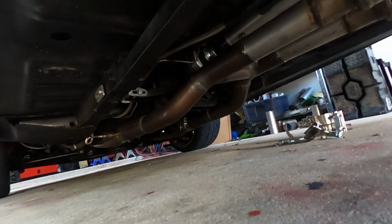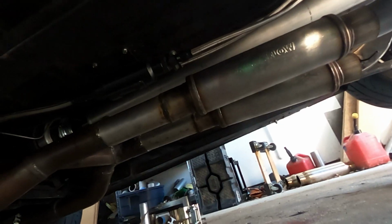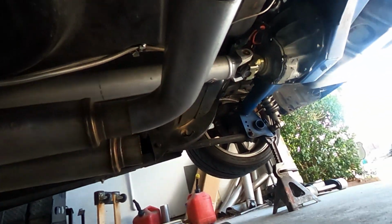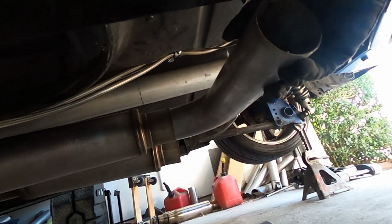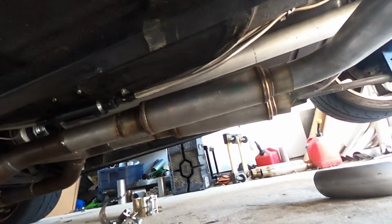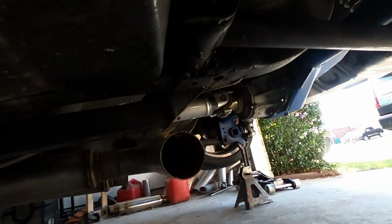All right, so here's how things are working out. So bolted up the H pipe, and then we slid in that little mid piece, which is going to have the straight piece with the muffler. And now basically this actually works out perfect placement. Don't worry, those mufflers are just sagging a little. We will have those buttoned up whenever they get those clamps put on there. And also there's a place where we have a hanger to support all that weight.